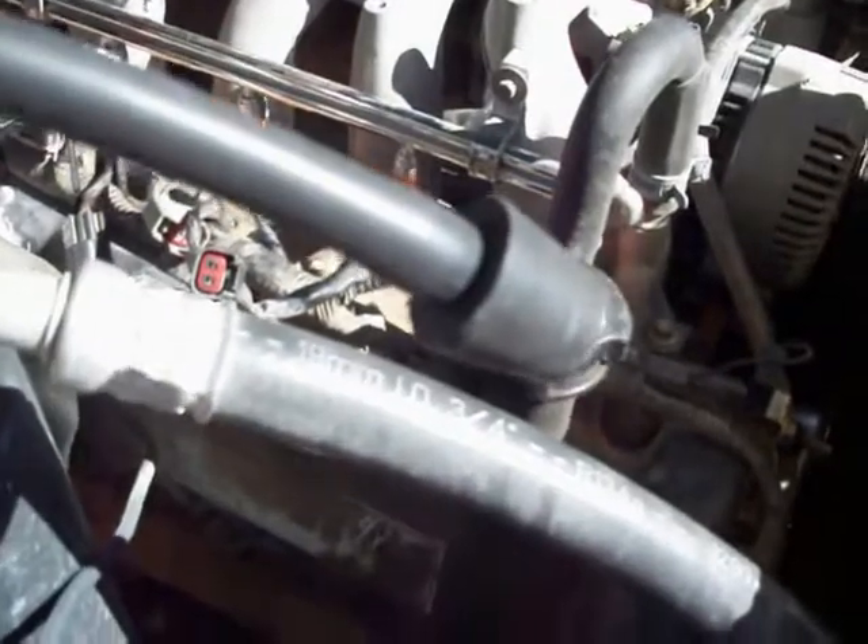So I'm going to try that right now. I've got this set of valves closed, but I can shove this back in there, put a little bit of air in it, and sure enough it'll pressurize up the cylinder and pop out. Then you're pretty confident that the valves are closed.